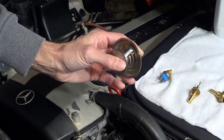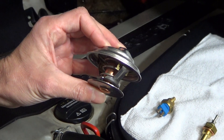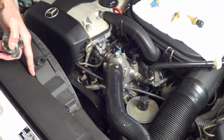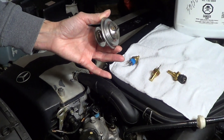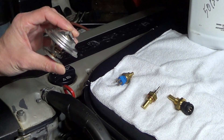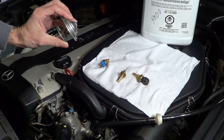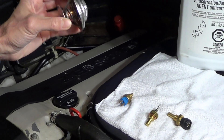You can modify this sensor. The original specs have an 87 degrees Celsius thermostat. You can go with a sensor as low as 80 degrees Celsius, and this should keep your car's engine cooler for longer. But if there is an underlying problem with your car's cooling system — likely because of limited flow in your radiator — then getting a lower temperature sensor only slightly delays the car from overheating. Some sensors even have a fail safe where they will never get stuck in the closed position, which is where you could get catastrophic engine damage. Mercedes branded thermostats won't have this fail safe and most are at 85 degrees Celsius, so you have to go off-brand, but there are a number of good quality thermostat makers in the world.